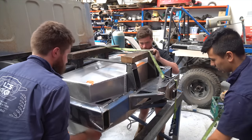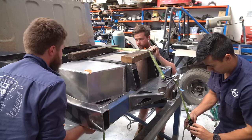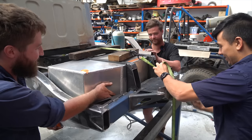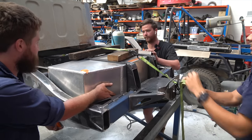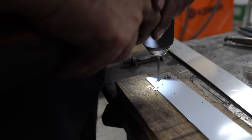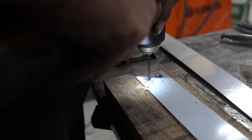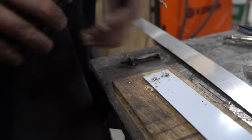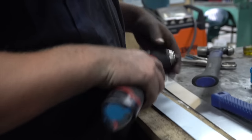Then the fuel tank can go in, which was made easier with a few extra hands. We're using a high-tech ratchet strap to hold it in place for the time being. Let's make the stainless straps now. We're using stainless for the fuel tank strap material as it behaves well under tension and cyclic loading, and of course we don't want it to rust. These straps were cut from 1.2mm thick stainless on the plasma table.